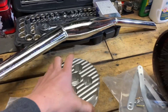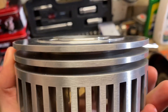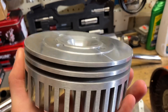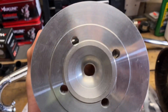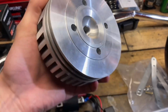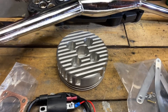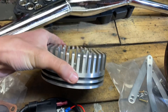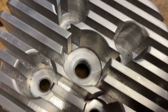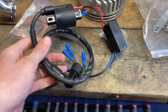As far as the cylinder head goes, there are quite a few things about it that make it better than a stock cast head. First, you're going to notice the deck height is a lot lower than your standard head — that's going to increase your compression from around 100 PSI to 120, depending on what you're running. The dome profile is a lot smaller, so once again that higher compression boost gives better burn. Also, it's a hemi-style head instead of an angle fire, so it's going to burn the fuel a lot better. The cylinder head has a really nice cooling ability because of these tall high-riser fins that allow air to pass through and really cool off your motor. And a lot of stock cast heads have problems where the spark plug will leak — that's not an issue here because it's machined perfectly flat.